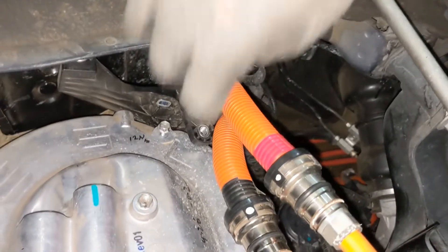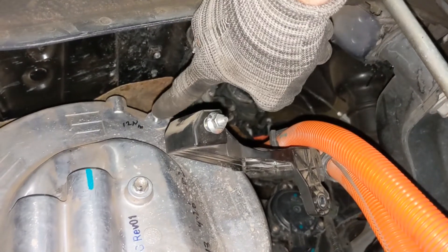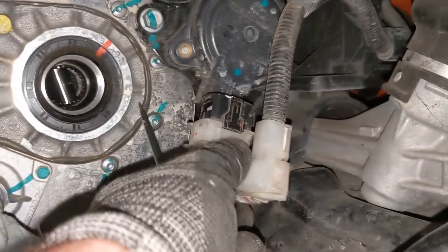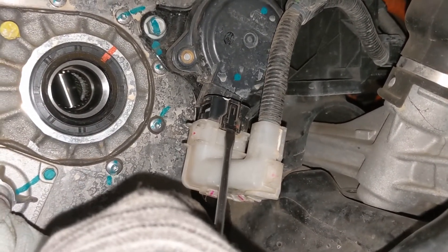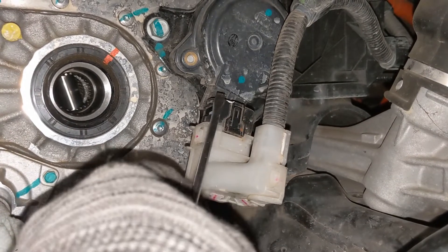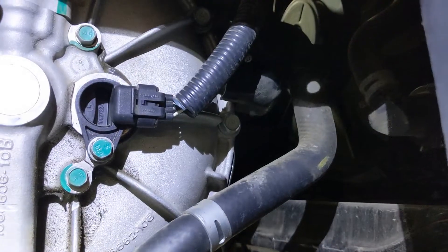Next I remove this plastic injection molded part over here — it's the wire harness protector. It's fastened with a bolt over there and a bolt over there, and at these two easy-to-reach locations. I also disconnected this cable over here. Make sure that only on this side you push this lever over here, so it hinges over this point, and then this part comes up and disengages from this little protrusion over here.